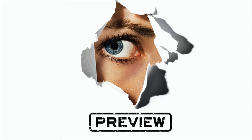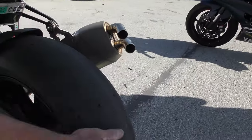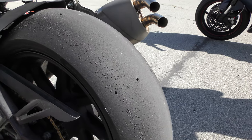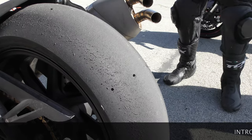So this is your spring pressure. If we get to Thunder Hill and it's 110 out and it's 85 degrees by 9 a.m., that ain't your pressure. I went out at 25 in the back and came back in at 31. So that's a 6 PSI gain.